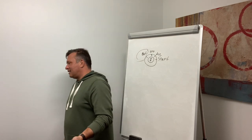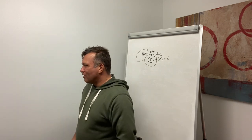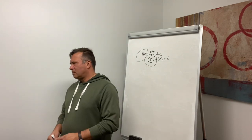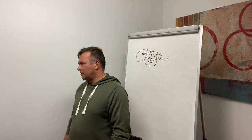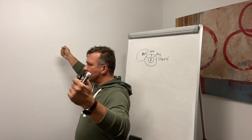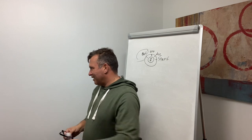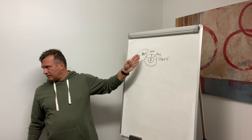I know that it's stated somewhere in the paper, probably when you're doing your course, or on the knowledge test, that every time when you're leaving the truck, have the key with you. We don't do it. We make sure that you pull the air brakes, put on the parking brakes, it's in neutral, and then you're leaving the truck using 3 points of contact. That's what you must do, otherwise you will be disqualified. But you don't have to shut the engine every time, so that's why. Make sure it's in off position, not in accessory. Okay?